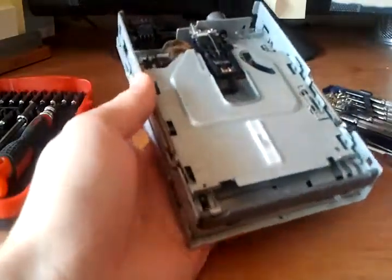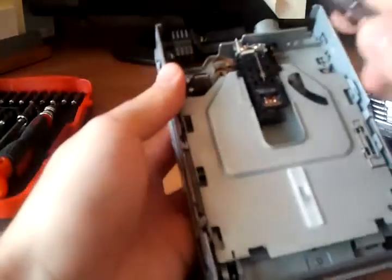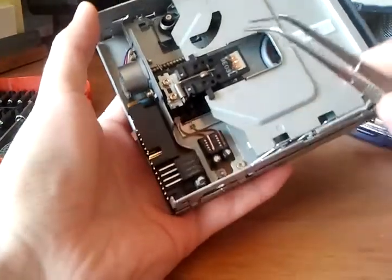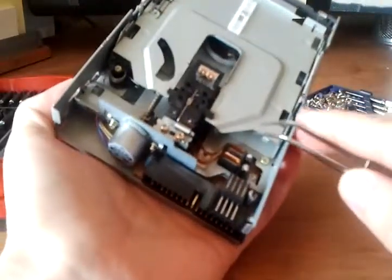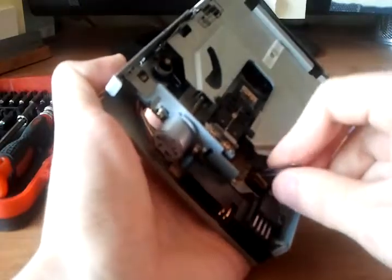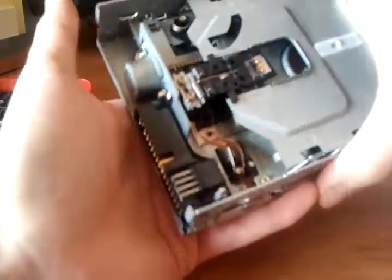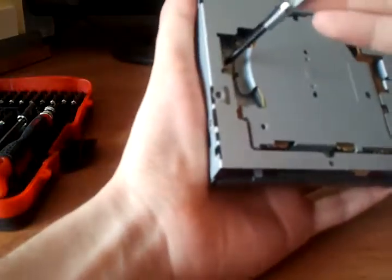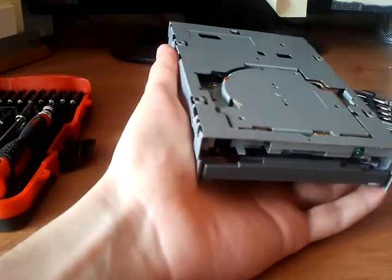Let's take the disc out first. Now if you can see right in here, there are two cables — not ZIF, actually they're friction-fit cables — which go to the heads right here. So let's take those guys out. I always hate this, I don't have fingernails. There we go. With those out, next I'm going to go for removing the bottom plate. Looks like you're going to have to remove a few screws — lost that screw — in order to remove this bottom metallic plate here.